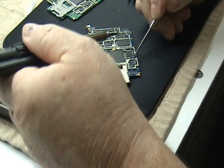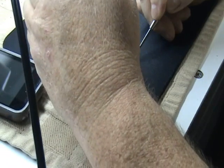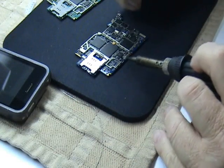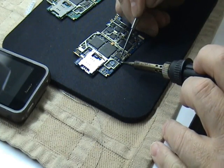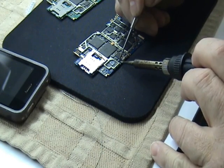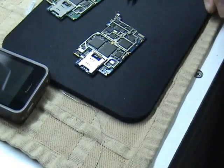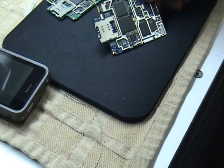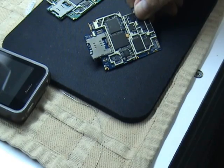I've got that there — I'm going to hold it, give a little pressure, hold it down. I'm just going to put my solder and iron over here, let it melt that solder on that back pad — it just falls right on there. Same thing on this side — it's kind of a flat one, turn it flat, put it on there. It'll just heat the solder on that pad, and as you're giving a little pressure down, boom — it just sits right on there. That's the repair done right there. It's not really that complicated, and that was done without even a magnifying glass.